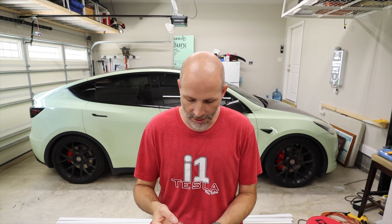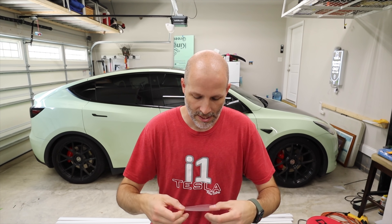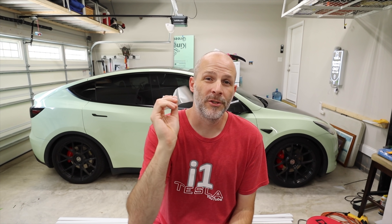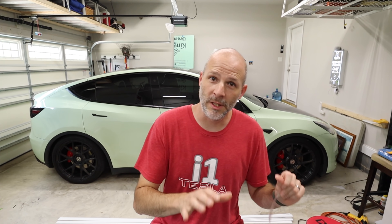I'm not a huge fan of paint protection film for color changes, but the clear version is amazing if you like your car's color — it gives a lot of protection. This stuff is super strong, seven and a half mils thick; it can take a rock chip really well. It is very tricky to install though. You use a soap-and-water slip solution to position it, then an alcohol solution that tacks the film, and you squeegee the water out. There are no channels for water escape, unlike vinyl. You do see some of the edge lines, and it takes about a week to install.